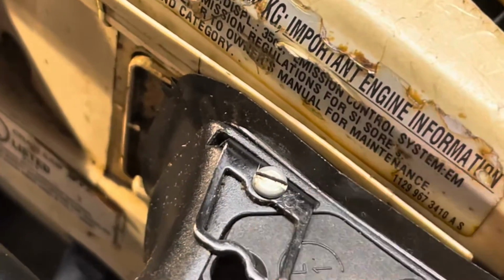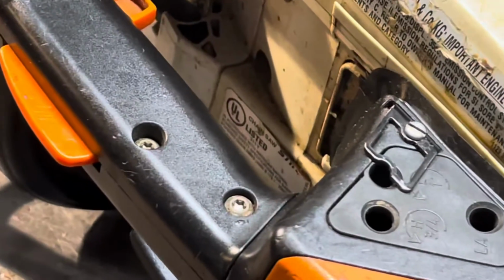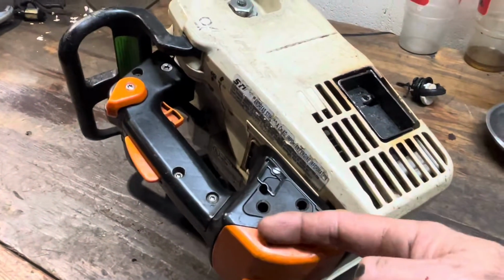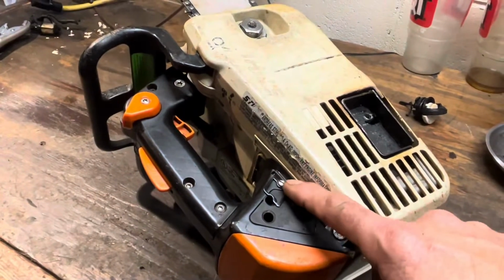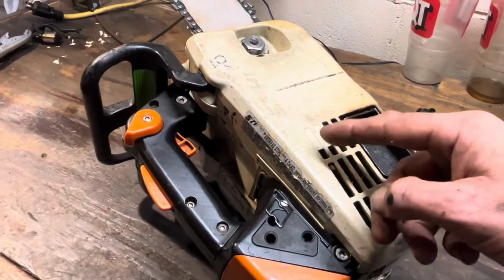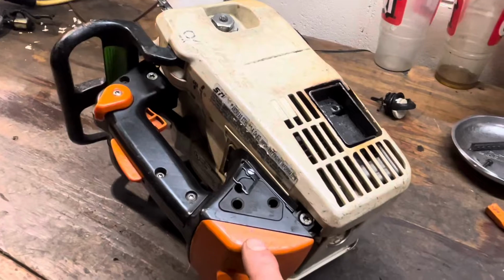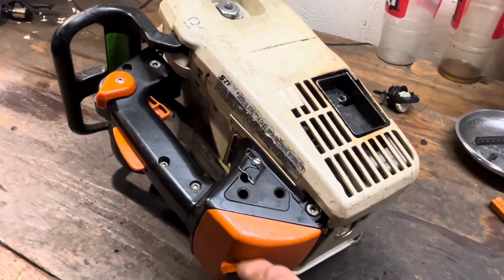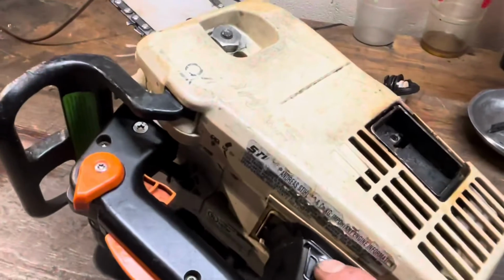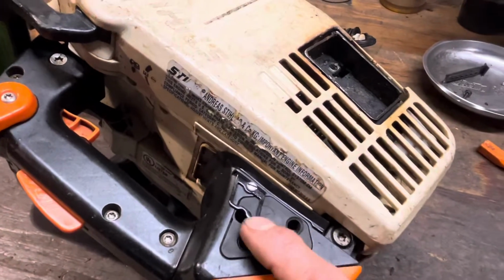Okay, don't flip that around. Leave this in, because the other side of this is flat and it blocks off warm air from the engine to get in here. So if you're operating below 30 degrees, or outside working in 30-degree weather, then flip this around. That'll bring a little hot air from the engine to the carburetor box. So you'll have warm air and you won't freeze up your air filter, or you run a winter filter. But that will clear up some of the curiosity of what that actually does. Leave that there. Here in South Carolina, that's not going to get flipped.